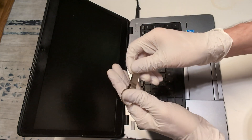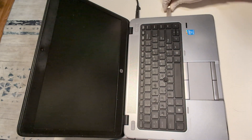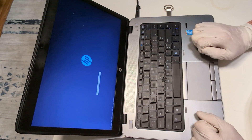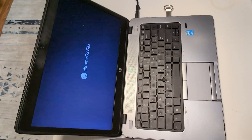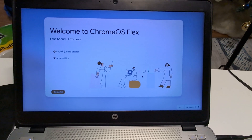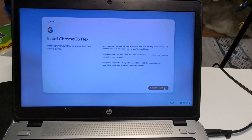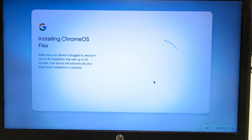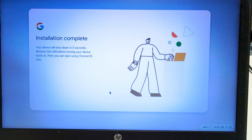This is the drive that has Chrome OS Flex on it. If anyone is interested in how to create one of these, let me know in the comments and I'll do a video about that. We're just going to slide it into the USB drive. We're going to turn this on and spam the F9 key, which should take us into our boot menu. From here, we are going to select our USB hard drive and begin to go through the startup procedure. We're going to do a fresh install of Chrome OS from this USB drive, and we're going to click install. It is very important to remove that USB before you restart the device.